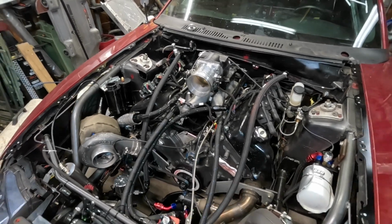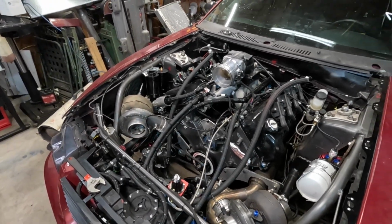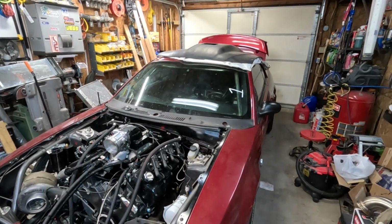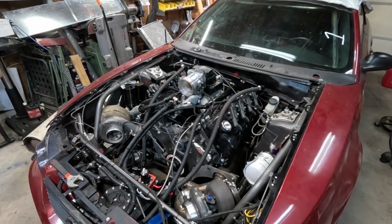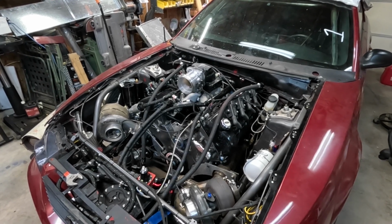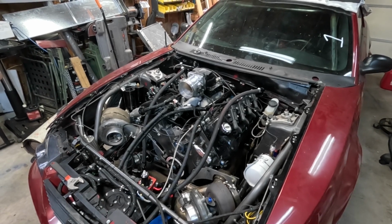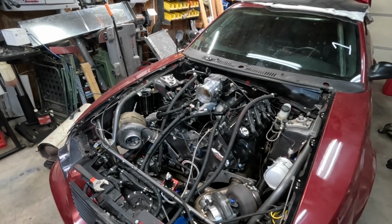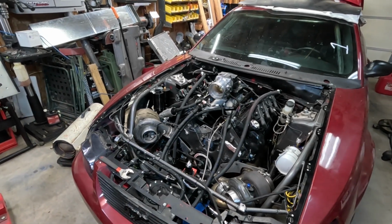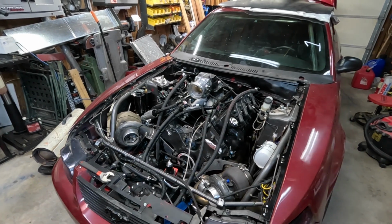Coming up on 2 years since I put out a video and gave any kind of update about this old 04 Mustang. Pulled the motor out and we ended up stroking it. It's a 301 cubic inch engine now. Good rods, good pistons in it, and a crankshaft, obviously. Went through the heads. Bumped the compression up. It's like a 12 to 1 now.